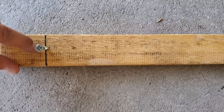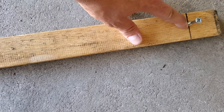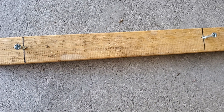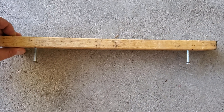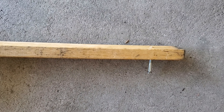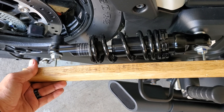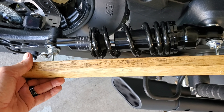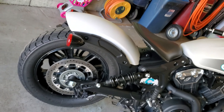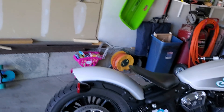So here's what I've done. I measured a point exactly — exactly-ish — 282 millimeters from each other. I made sure that they were the same distance from the edge, so they're centered in the board. And I put a screw in exactly at that 282 millimeter mark on each side, just until they started poking through on the backside so they're the same length, same type of screw. Check it out — without me on the bike, they're almost damn centered, which to me means I do not have enough preload on here. So if I sit on it, they will be too close together. But now I think I'll be able to sit on the bike while using this stick to measure and adjust my preload accordingly.